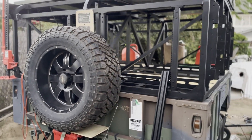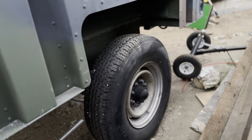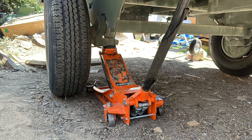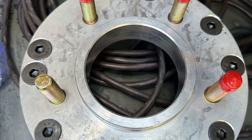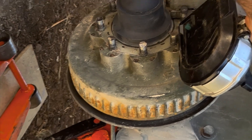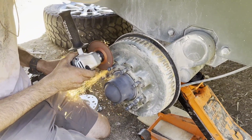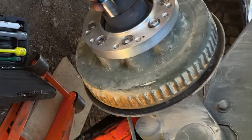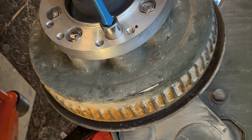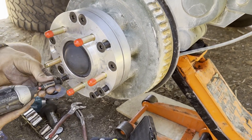You can see I have a full-size spare tire. I had to get wheel adapters made for the trailer — these adapters go from the eight-lug trailer hub down to the five-lug pattern my Tundra uses, so I can have one spare tire that works for both. We ran into a small issue because the trailer studs were too long for the adapter, and nobody wanted to cut them off, so we used a bandsaw to get the cut started nice and straight, then a grinder to finish. Once that was done, we mounted the two-piece adapter and the Tundra tire with no issues.